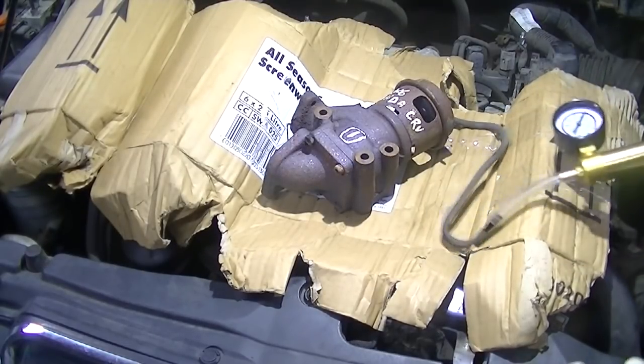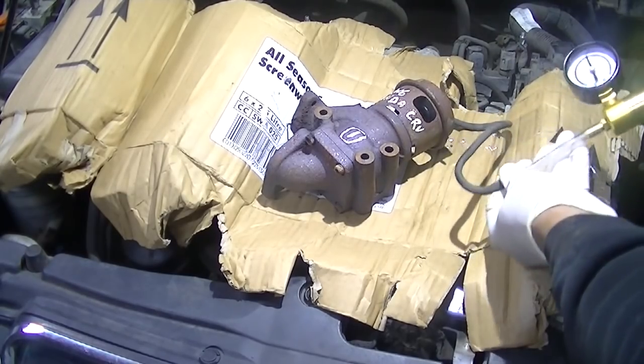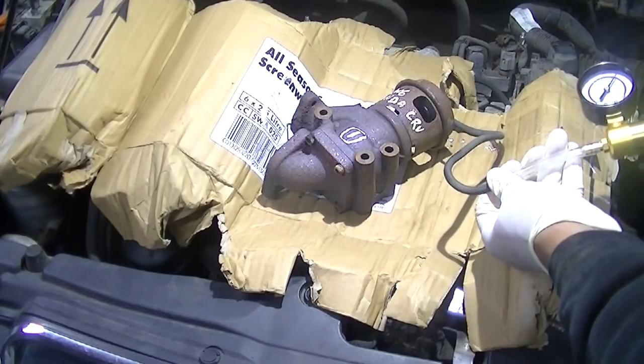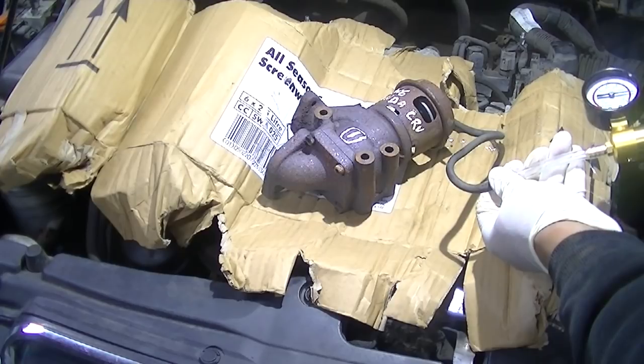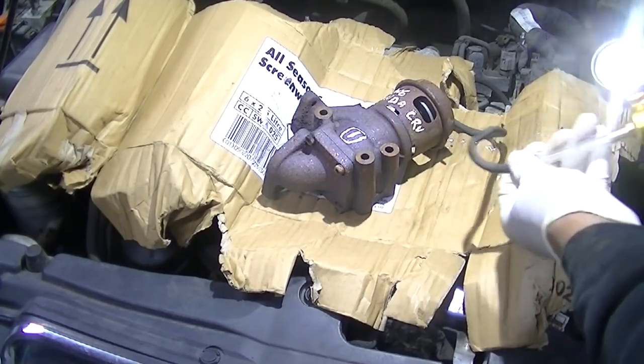Also check if you need a different vacuum hose, since they can have leaks. Really simple test — hand pump it up, and if it holds air you're good. Just releasing it now, letting it vent — just so you know it's working before you install it, so you don't have to put it on twice.